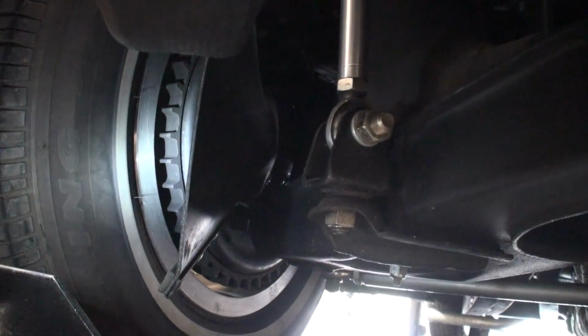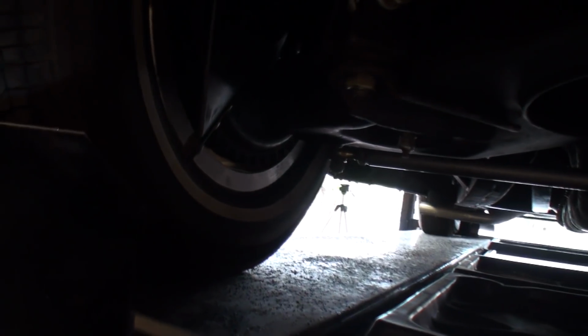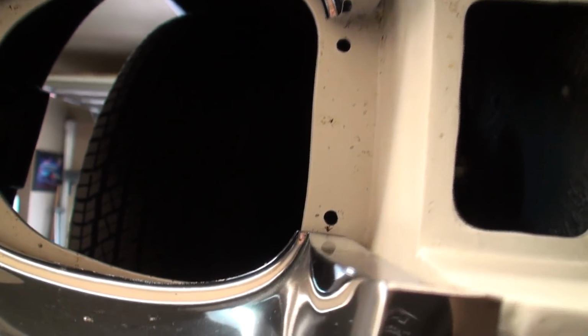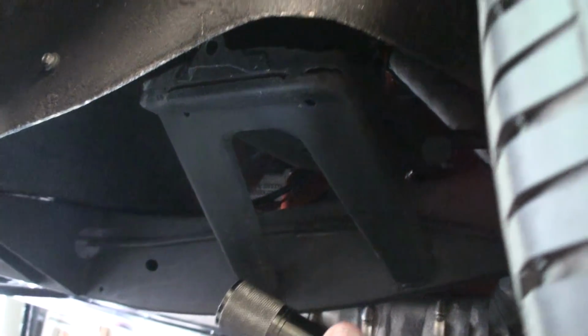We have the same thing front and rear, with the exception of the rears. They would have what they called diffusers that would blow it onto the brakes through ducting back there, but they would pressurize them from up here. Now this car does not have those transition pieces. Where my hand is, you would have had big fiberglass pieces up inside here, and then it would divert that air back down to the rocker panel to where these transitions are. That's just a block-off plate now, but it would basically pressurize this. That's what they call airbox cars, because that's the channel that is actually inside the rocker panels.